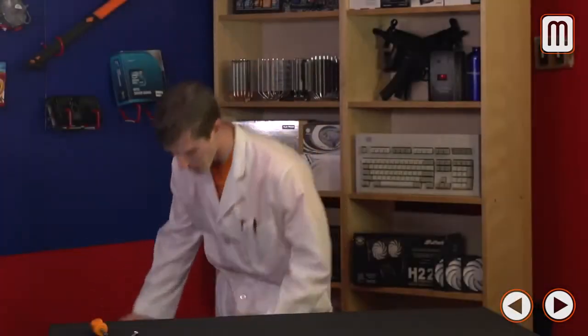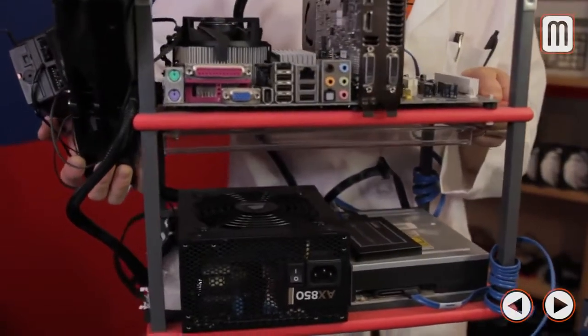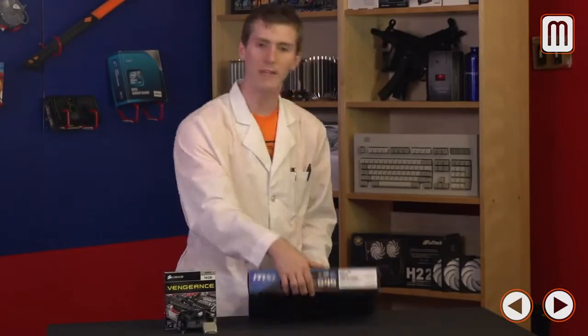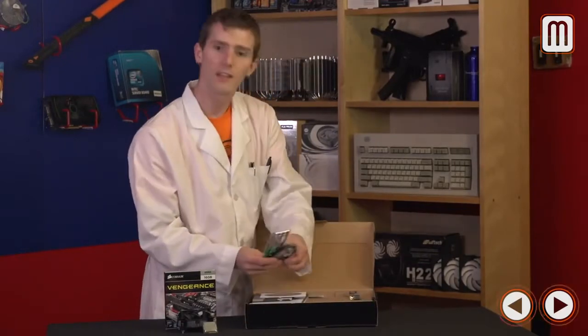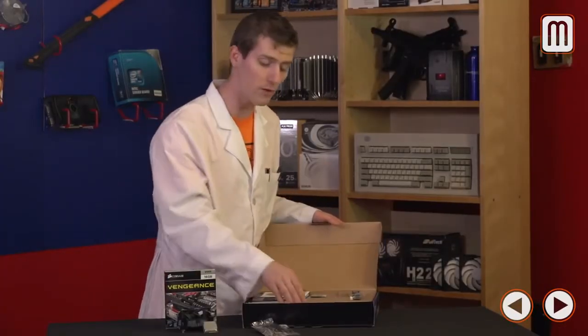Techs who do a lot of work might have a dedicated static-resistant test platform, but you guys watching this probably don't have one. In a pinch, a motherboard box is an optimal place to test components before installing them into the chassis. Before we assemble our ghetto test bench, we remove the motherboard from the box. The only pieces we need are the I/O shield and the SATA cables; everything else we'll leave inside. If we were running SLI we'd also take out the SLI bridge.